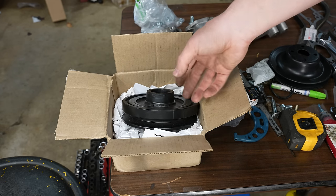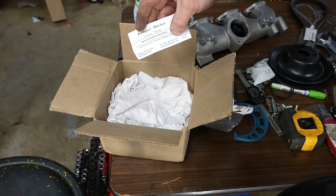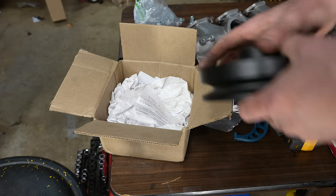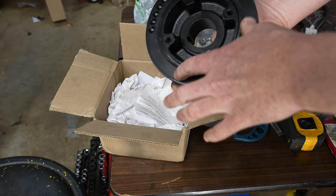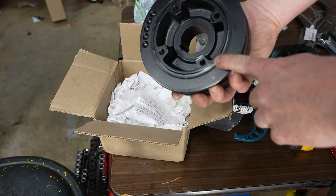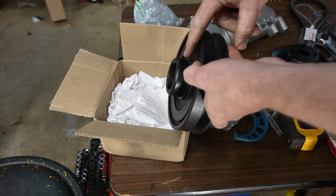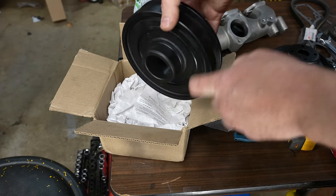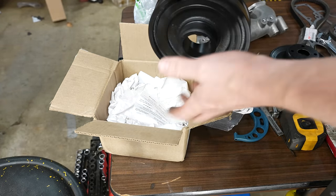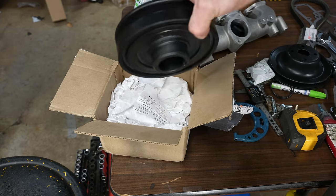Okay, speaking of pulleys, I got the damper back. It's been rebuilt. This was the damper doctor. The doc did it. What they do is they bake it to get the old rubber out, and then they inject some kind of special silicone into here. So that's all done. I still need to fix this sealing surface, so I actually have a speedy sleeve on order for it. So when that comes here, that'll be in the next video. I just need to strip the paint off here and install it, and then we should be good to go on that.